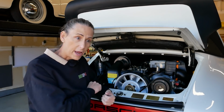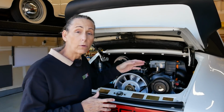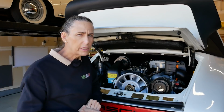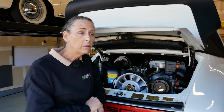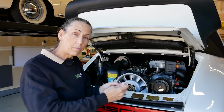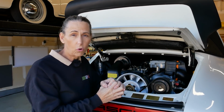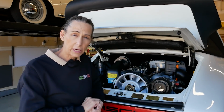If it's the intake valve, every time that piston comes up for compression, it would be pushing air backwards into the entire intake system. I don't think we're really seeing that either, but there's ways we can interrogate that as well. We can do a compression test on it. We can put a bore scope down there with a reverse mirror to look back up at the valves. We can check the piston. There'd have to be an awfully huge hole in the piston, or the rings would have to be non-existent, for there not to be any compression in that cylinder.